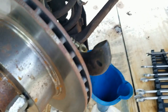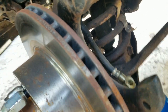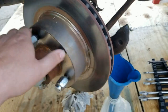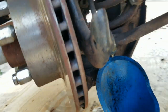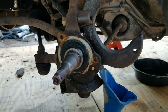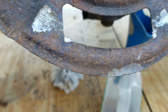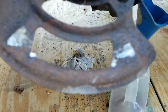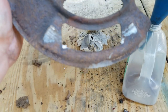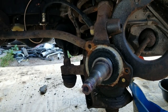This is the bracket that Speedway sends with their Mustang 2 kit. I think we can leave that on, but I thought I read that they want you to take the brake rotor off, which I think I'll do because I want to take this dust shield off — it's just a piece of crap anyway. Alright, so I got the dust shield off. As you can see, it was rubbing — I assume it was rubbing on the new rotors. That's why it's not going back on. It doesn't even cover most of the diameter of the rotor, and it was rubbing up there too.